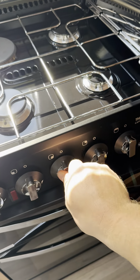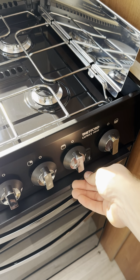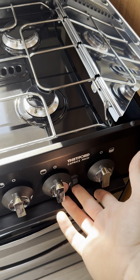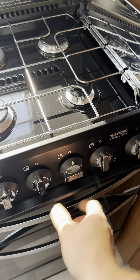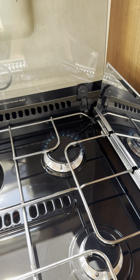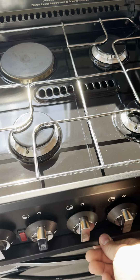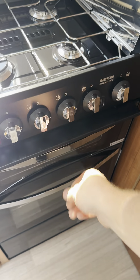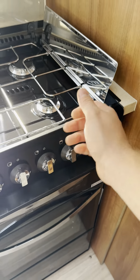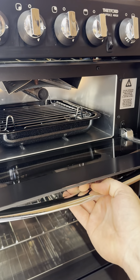The cooker — you've got options because this is a British built vehicle. They tend to cater for cooking a bit more than German vehicles. You've got the option of the mains ring, so if you're hooked up on the mains you can use that hot ring by adjusting this switch down here. You've then got the gas burners up on the top: bottom left, bottom right, top right, and then grill and oven. To light any one of these, you've got an ignition switch just here — push in and turn on whichever one you want whilst pressing the ignition switch. Two things to note: when using the grill, make sure you pull this little cover out here to save these knobs from getting corroded from the heat, and leave the grill door open when you're using it.